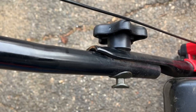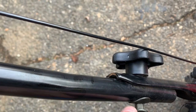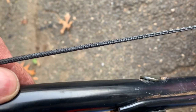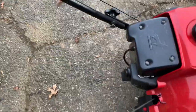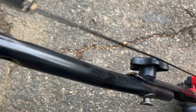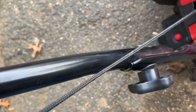Lastly, another thing I found — look how this guy had the handlebars on. That's not right. That curved washer should go on the outside and underneath the knob so that the end of the carriage bolt can go into the handlebar. I corrected it on this side so the carriage bolt goes all the way into the tube, then the curved washer, then the knob. I'm going to correct it on the other side — that would make for flexy handlebars before. Now he's going to have nice, tight, stiff handlebars. We'll talk to you soon.